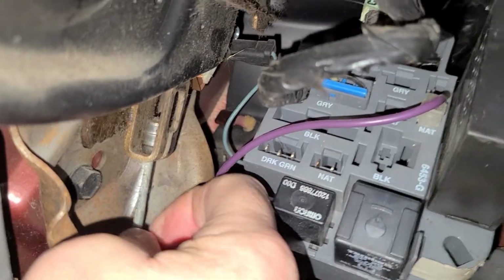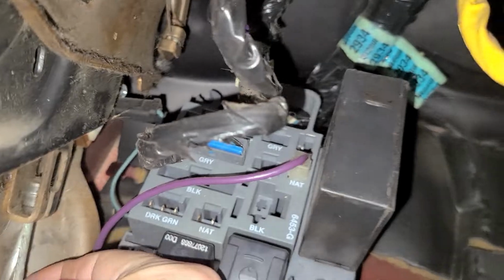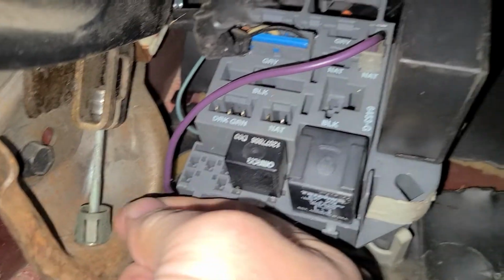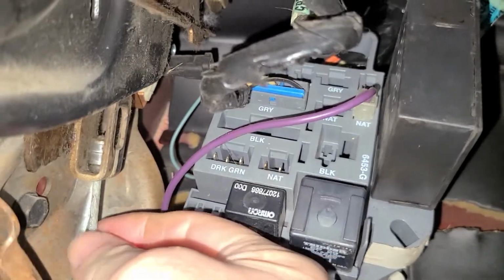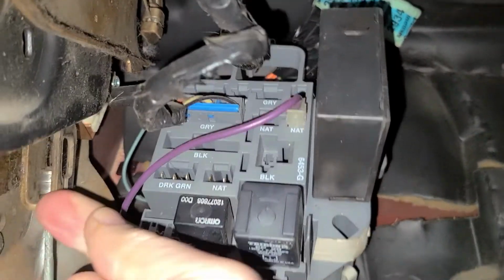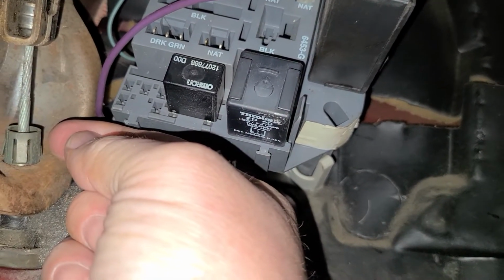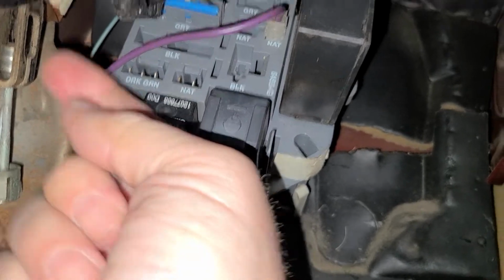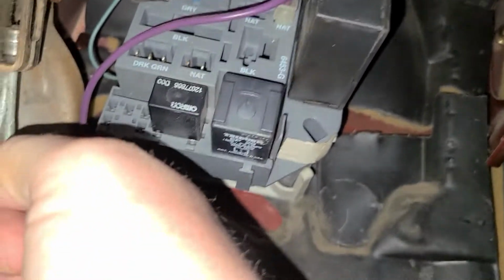And then with the new cable, you'll have to compress that spring again and re-loop it into the hook, and then just release the spring and it'll hold itself tight in the drum. And the same thing up here. Best way to do it is to push the parking pedal down again, and as long as everything is still a little loose, just take the pliers, pull up and link it in, and then release the parking brake lever. Actually, no, that's backwards, because it pulls up. So you leave it down and just pull the cable, vice grip it and pull the cable up and in, and then you go underneath and tighten everything down.